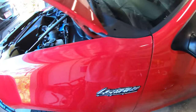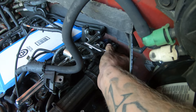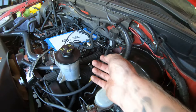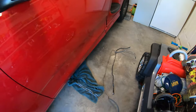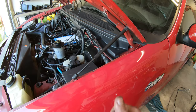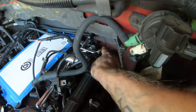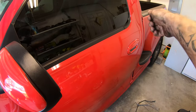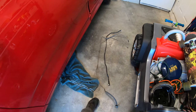So we got that half disconnected. Now we're going to come up here and disconnect these two lines — you just pop these little clips off. Use your fuel line disconnect tool, slide it underneath there, and it should slide right off. So that's the rest of the hard line here — wasn't too bad. There's just a bunch of clips along the way you'll have to push it out of. The hardest one was the one near the motor — I had to use an Allen wrench, go behind it, pry it to get it to pop out. It is the right-most line — that's your return. Disconnect it, disconnect it out of all the little clips from the fuel hat. Hard line's out, didn't have to do any cutting.